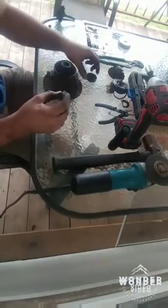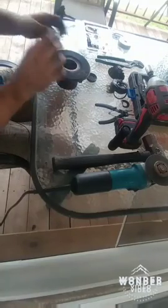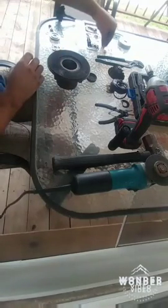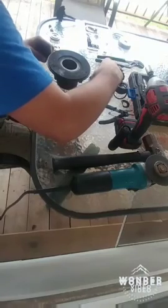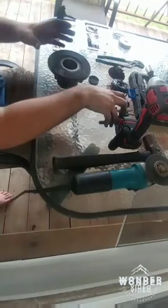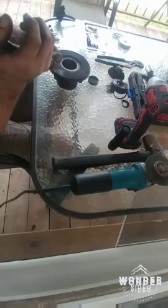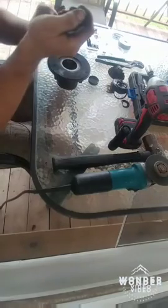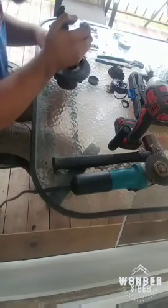Now that it's all cleaned up and everything's clean on the inside, you need to have a little cup of oil so you can oil everything. First we're going to go to this side of the turbo and start with one journal bearing. Lube it up real nice and good and drop it down the hole. It doesn't have to be oriented any specific way - if it was a ball bearing turbo it would, but because it's a journal bearing it doesn't matter. Take a snap ring and make sure it's seated real good down in there.